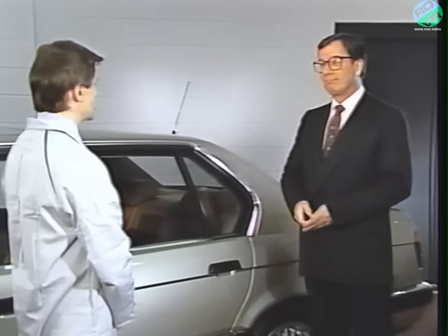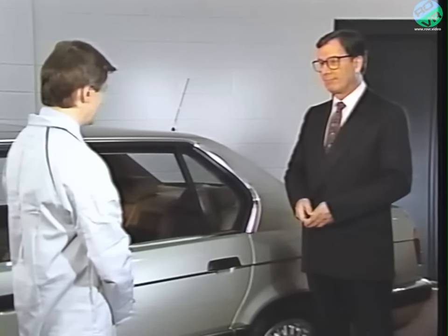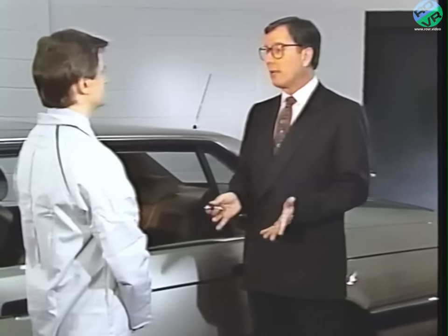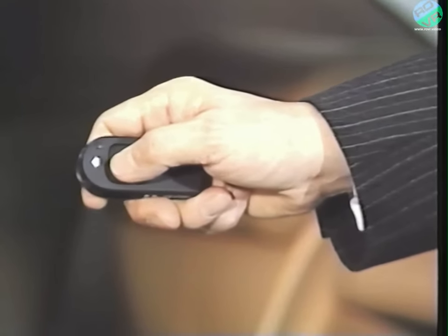With your 750, in addition to all of the features of the BMW central locking system, you have the added convenience of the infrared locking system. Convenience is the right word, George. I can be up to 20 feet from my car and lock, unlock, double lock, set the alarm, or even close the windows or sunroof if needed. It's easy to use — just point the rounded end of the infrared transmitter toward the receiver by the sunroof switch.